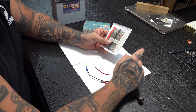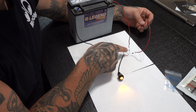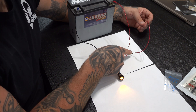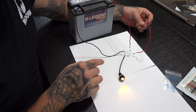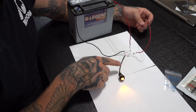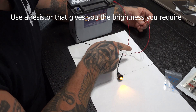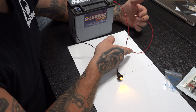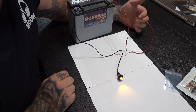I'm going to throw together one right quick. So your constant power runs down to this resistor, and this resistor is tied together in a Y shape with this diode. This resistor is bringing down the amount of power going to this light, making the light dim — you saw it before and you see how dim it is now. It's bright enough to where you would see it on the road, but it's not as bright as it was. This wire here is what would be going to your intermittent power, like your turn signal switch or your brake light or whatever else you would want to put a dual-phase LED on.